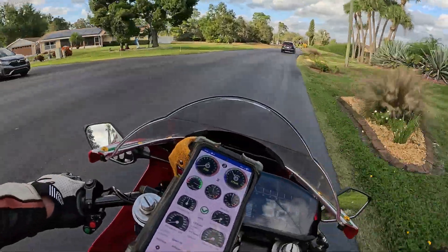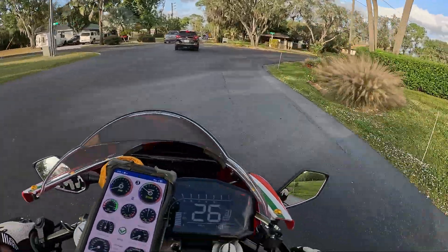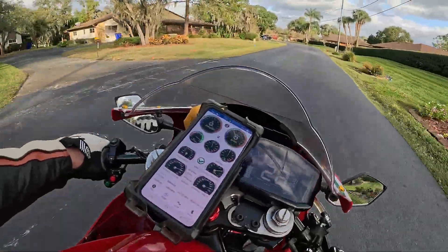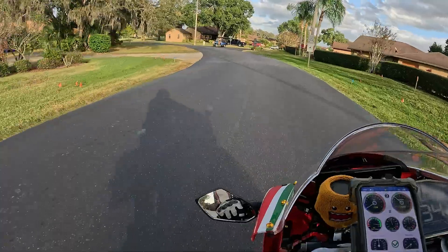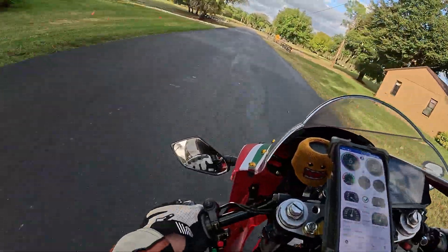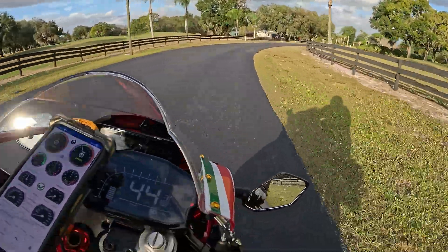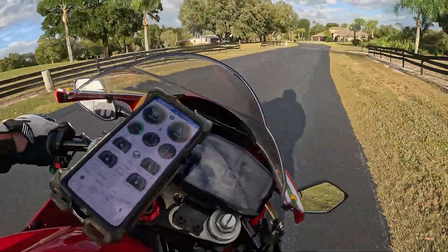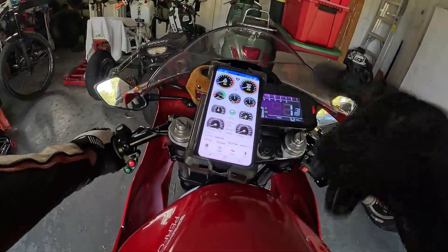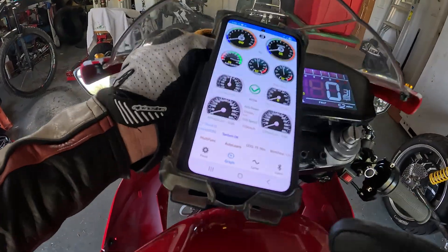I'm not making up this upgrade though — this is what some experts are telling me to do so I can dump more amps to get this thing faster. And to dump more amps, I have to get a bigger controller. Right now I'm limited to 600 line amps and that's what's killing me on this bike. Some of you reviewing my graph page were telling me that even with a bigger controller, this battery would not dump the amps I need. So I've got to get something that'll run higher line amps, or the controller upgrade will not be worth it.